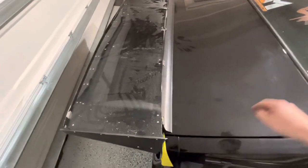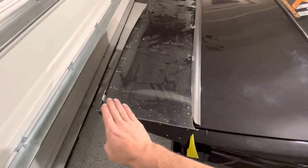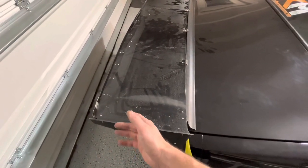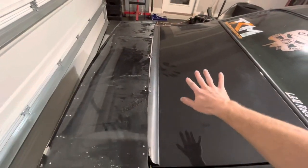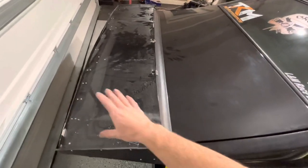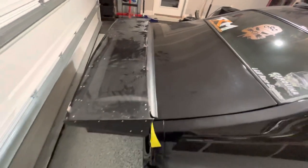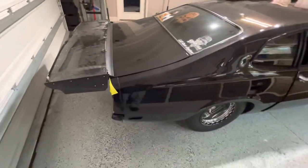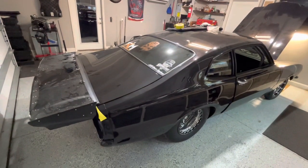I have a whole aluminum sheet and then have no struts going down — actually have braces under it coming out, so it's a strutless wing basically. Then have it where the Zeus fasteners are off so you pick up the whole deck lid, spool, everything built in together — super lightweight because it would literally just be aluminum with Zeus fasteners. I was going to do that over Christmas break and then decided to hold off on it and not do it right away.